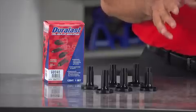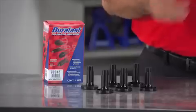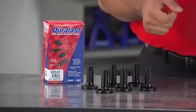Some vehicles have wires and some have coil-on plugs. When equipped with the coil-on plug, the ignition coils are mounted directly over the spark plugs. These applications still have a spark plug boot that wears down just like a spark plug wire and need to be replaced during a tune-up.